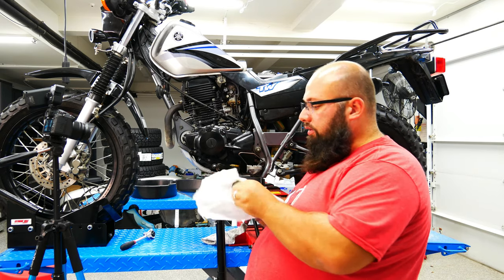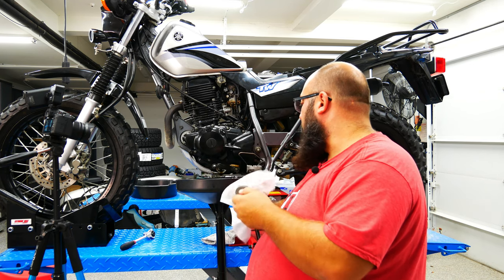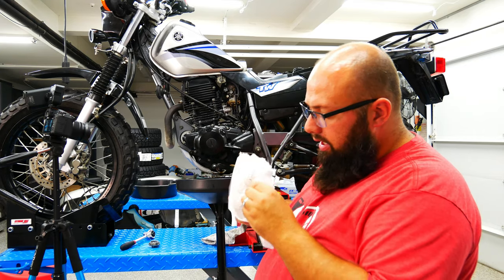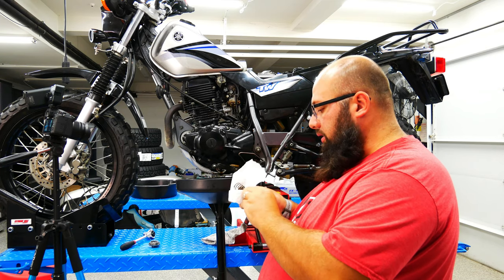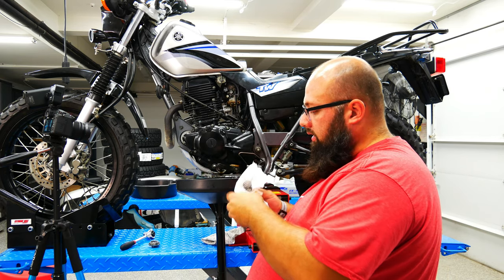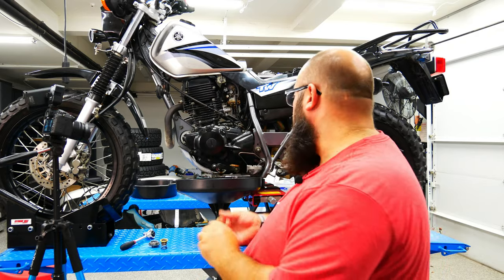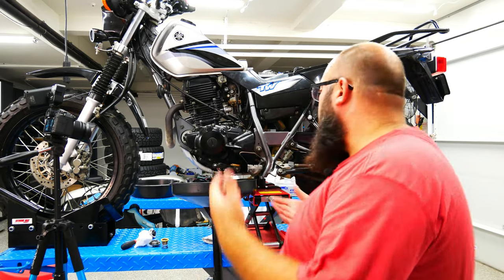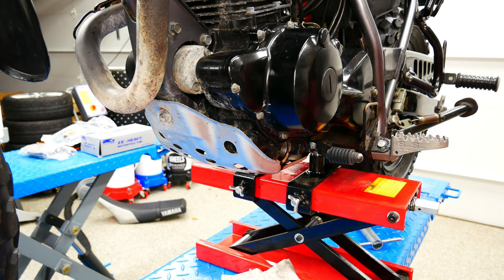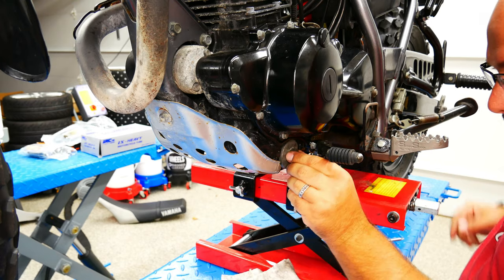Now that most of the oil is out, you want to wipe down the plug. I'm not replacing any gaskets — they all seem to be fine. Then check your filter and spring here to see if it's all clogged up. I've seen people clean these with brake cleaner, so if yours looks a bit dirty go ahead and spray it down. Mine looks relatively clean so I'll leave it. I'll let this drain for about another minute, then close it all back up, remove the oil pan, keep a rag under here for residual, and reinstall the spring and drain plug.